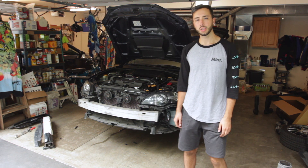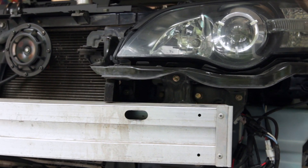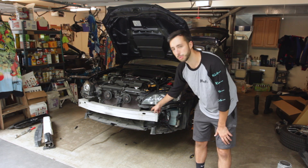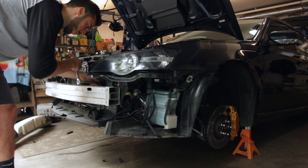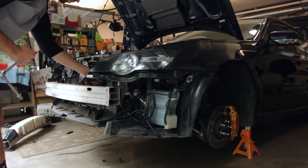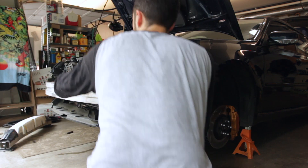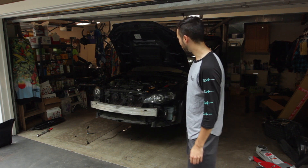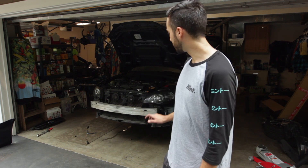After taking a closer look, I'm going to take off the headlight brackets before removing the crash beam. That gives a little extra clearance between the two when removing it, and these have to be replaced with the JDM ones anyway. Once the headlight brackets are off, we'll pull the crash beam. There are four bolts on either side holding it — those are 12mm bolts. Then there are a few more smaller pieces to get off before starting to install the JDM components.